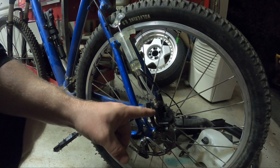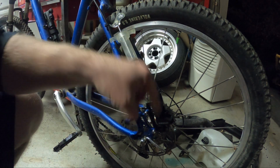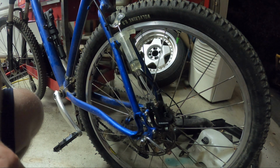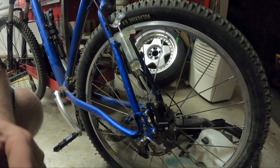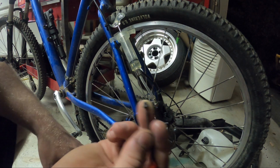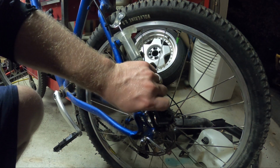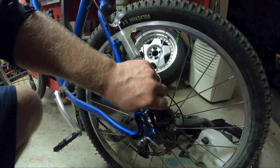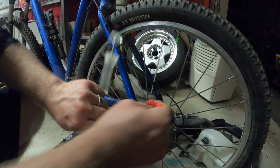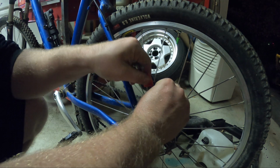We're going to take this off. It'll gravity feed through and should keep air from going in this way before we close it off. And then the top is just naturally the highest, so no air should be introduced up there. And we do the same thing. We'll unscrew the bolt and hot swap in the plug that came with it. Yep, fluid's bubbling out. This is so messy.